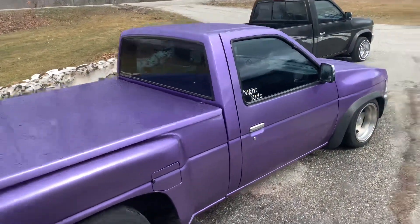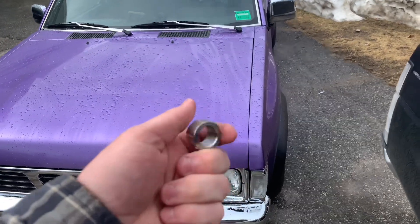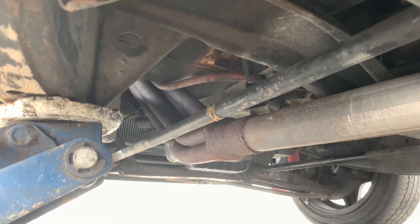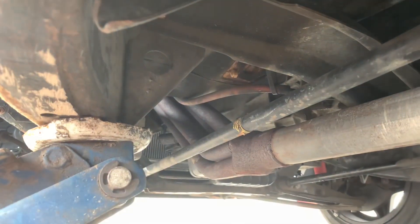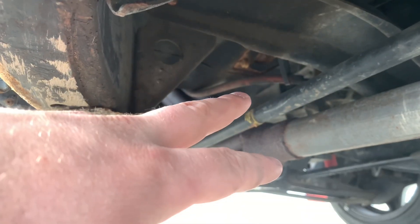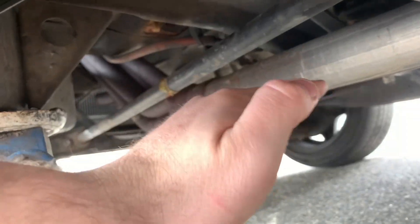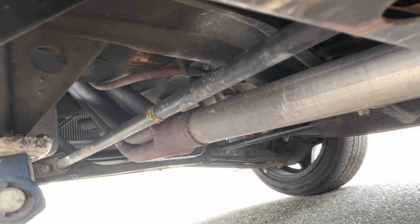While I'm waiting for the fabric to dry, we are going to take this little fitting and drill out a hole on my exhaust to apply it and weld it. If you have a turbo, I think you want the O2 sensor to be at least about three feet away. But if you're just going off the block, it's like 12 inches after your manifold — and 36 inches if you're boosted. Probably going to go somewhere down here, which should be plenty far enough away, and just see if I can get a drill up there to get a good diagonal angle. You don't want it directly on top, you don't want it directly on the side, and you don't want it pointing downward because any condensation will ruin the gauge.